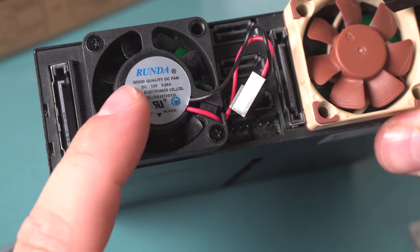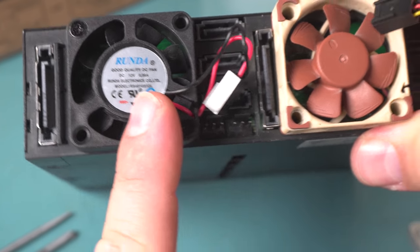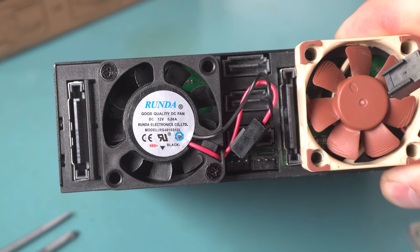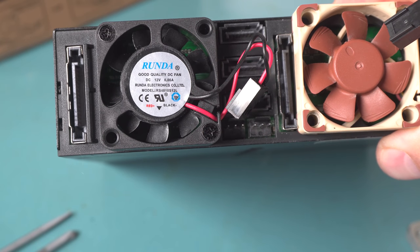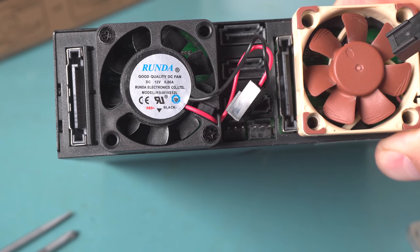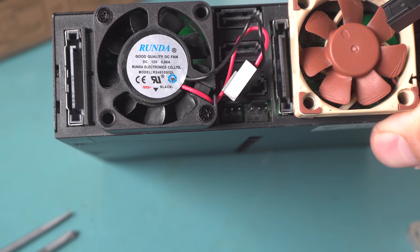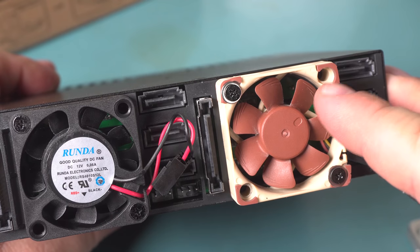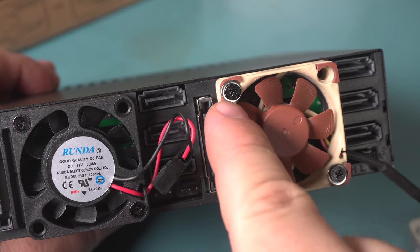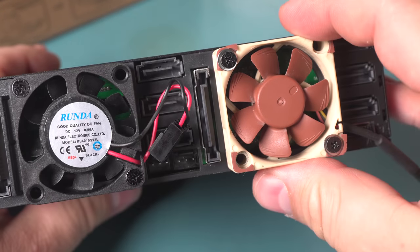I'm not sure if I'll be using the low noise adapter, but we'll see. The only reason I'm keeping this fan on is simply because it holds the screws until I'm ready to use both sides. The included fans are actually quite quiet. I tend to put Noctua fans in everything, and in my experience running it so far it seems pretty good. They're quite quiet and don't push a lot of air, but you don't really need a ton when running SSDs. Because the counter-sinking on the Noctuas is quite a bit lower, you might want to throw on an M3 washer to keep the screw from going in too far and brushing against the board.